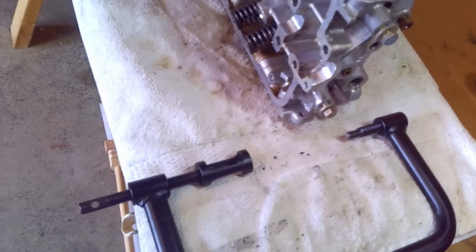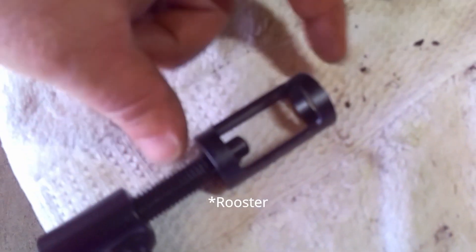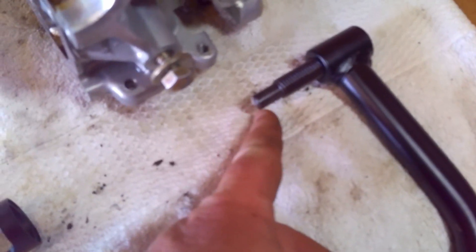This is the tool that I'm using — it's for small engines, motorcycles, things like that. It works really well. This piece right here compresses down onto the valve stem retainer on the top, pushes it down, and allows you a window to get in where the valve stem keepers are at. This part on the back butts up against the valve to prevent it from opening. So I'm going to get this clamped on and show you how it works.